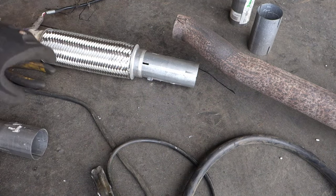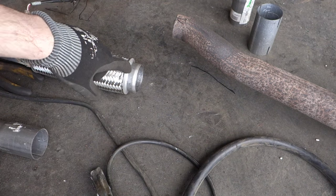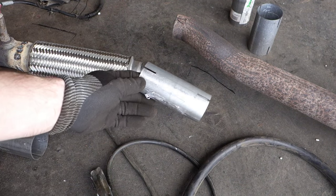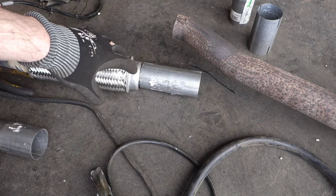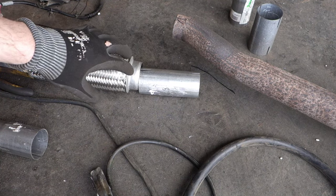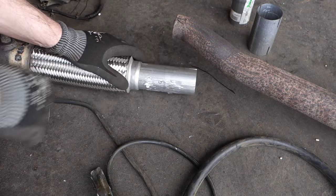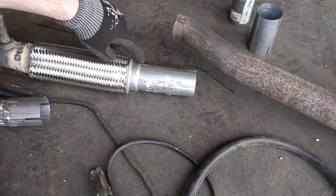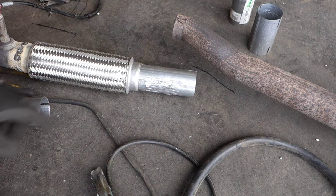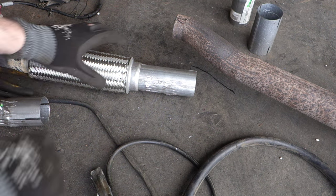it goes inside my muffler also, something like 1/2 inches. When we look, no, that kind of butt joint is a bad joint, but when this goes inside a little bit like in that way, 1/2 inches, this is good, and then welding in here, and then it lasts like 3 to 5 years. It is quite okay.